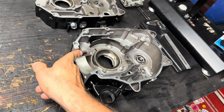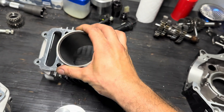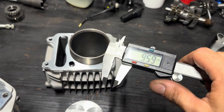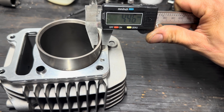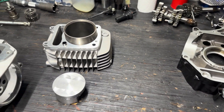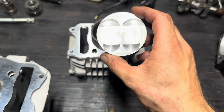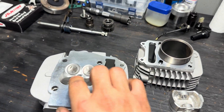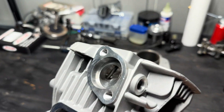I already bored the cases out — I had to bore the case out on both sides to make the new cylinder fit. This is a new 64 millimeter cylinder. They do sell 64 millimeter cylinders that you don't have to bore the case out for, but they are really thin and they end up cracking on the sleeve. I got a really thick sleeve — it's basically four millimeters thick. I could bore this out bigger and still be safe, but right now it's going to be a 64 millimeter piston. It's a custom piston cut for the four-valve head, and it's basically a Coso four-valve head with bigger valves, CNC ported and polished on the exhaust.